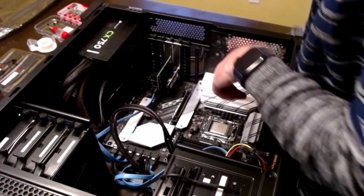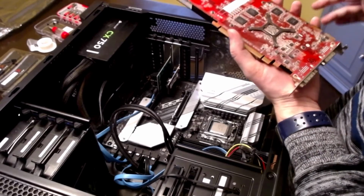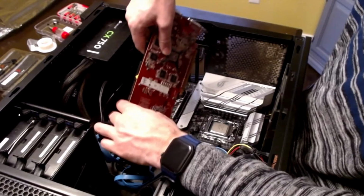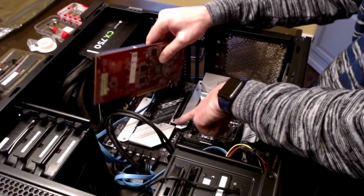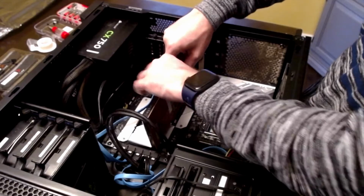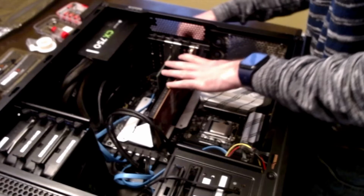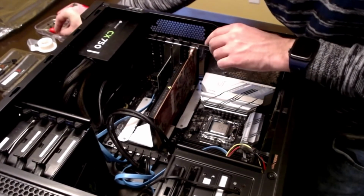And then the next thing here, you'll see I have 2 open slots. That's for this one and this graphics card, which isn't that great these days. Back in its prime, it was alright. But this one here I'm actually going to place in this big slot. You've got to push that down. That way, there's a little hook here that's got to set in there. So make sure that it slides in. You hear it click. That popped that back up. That hook did. And so now I need to put the screw in place for it.